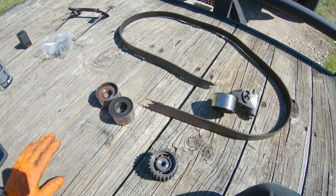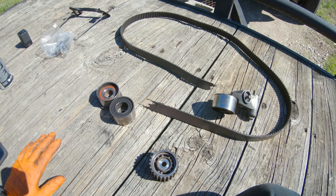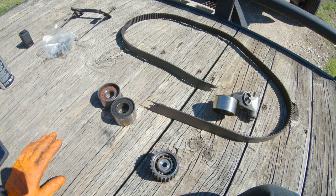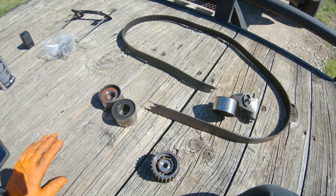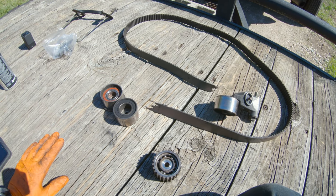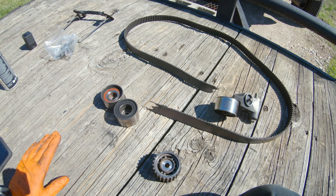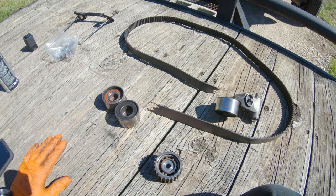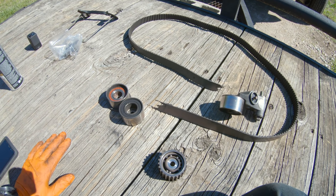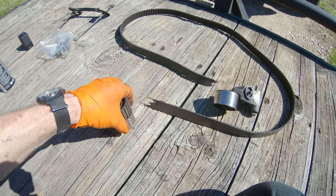I don't see any evidence that valves were dinged. If they were just barely kissed enough to maybe drop compression a hair, but not enough to lose compression in each cylinder. Like I said, in a later video, we're gonna pull out the spark plugs, do a compression test, do a cylinder leakage test, just to 100% guarantee the health of those heads, valves, and this engine. But just from the way it's running, I'm pretty sure it's safe.